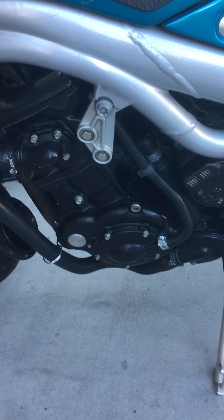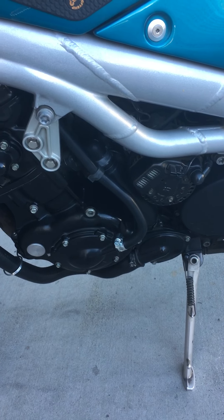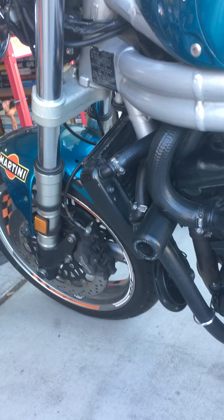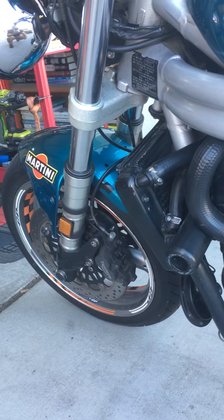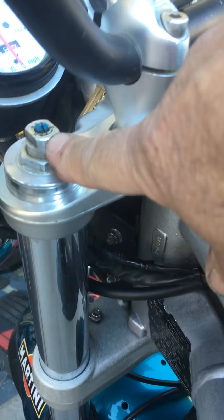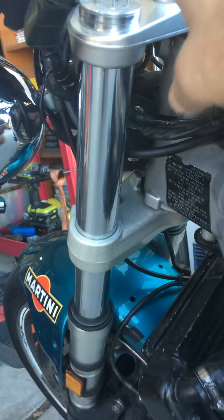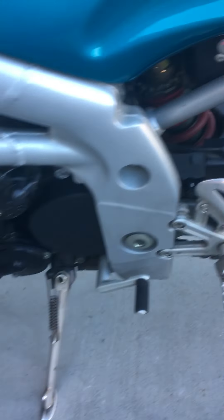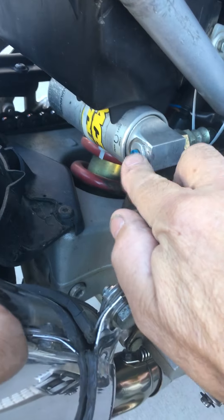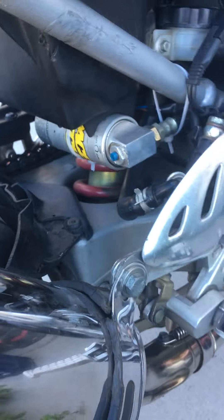It's perfectly rideable, but it just consumes a little bit of oil — not a big deal. The suspension is really tight. It's good if you want to take corners fast. The seals have been done for the forks — it's fully adjustable, with preload and damper settings up top as well as on the bottom. Same for the rear — it's been upgraded with Racetech adjustable suspension, with adjustment underneath as well. I got it adjusted for my weight, about 190 pounds. I like it kind of stiff because I like to take corners fast.